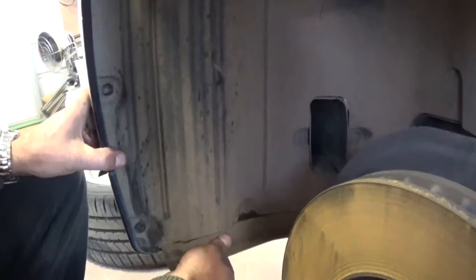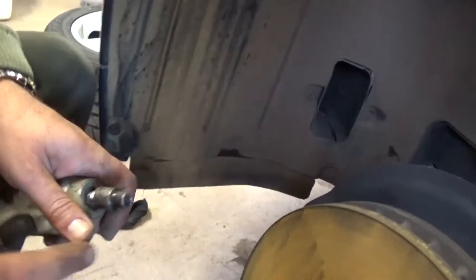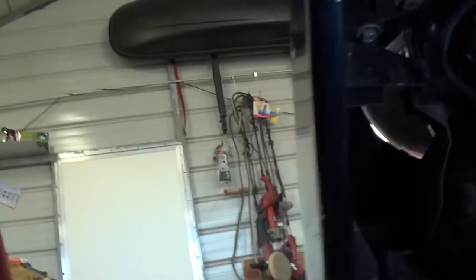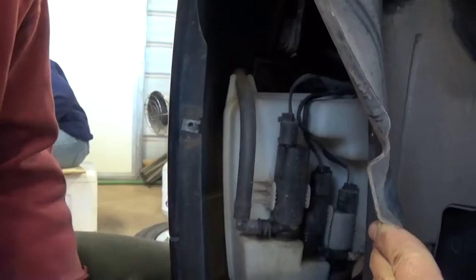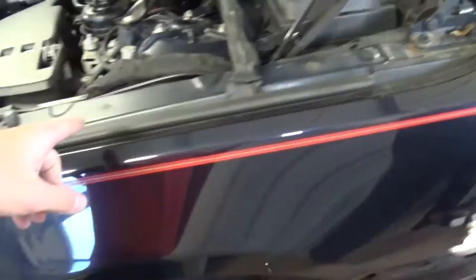That's what it looks like — just a regular screw. We need to remove a couple more so we can pull the liner to the side. Then you can just pull the fender liner to the side like that. Right there we have two more bolts with the 10mm to remove — actually three long screws. We got those out.